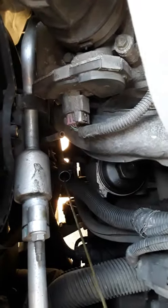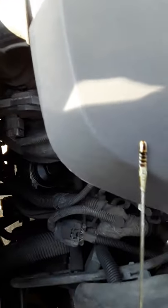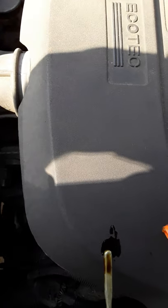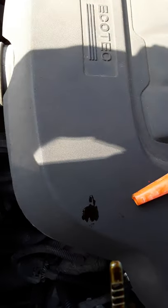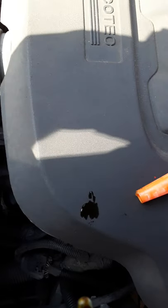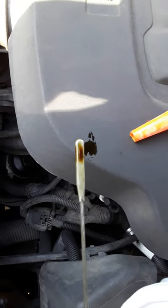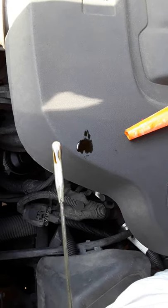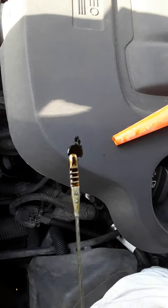So we've wiped it off and it looked pretty much okay. Put the dipstick back down into the hole, push it in nice and tight, pull it out, keep it level. As you can see, this particular car looks pretty good. If you pull it and look at the back, it's about in the middle, and rotating it around that seems to indicate we're potentially about half a quart low.